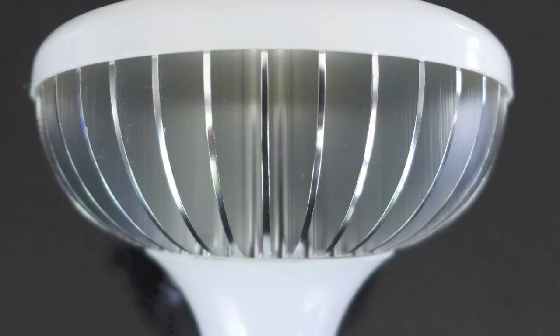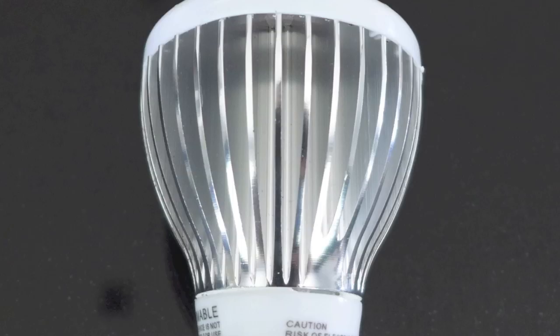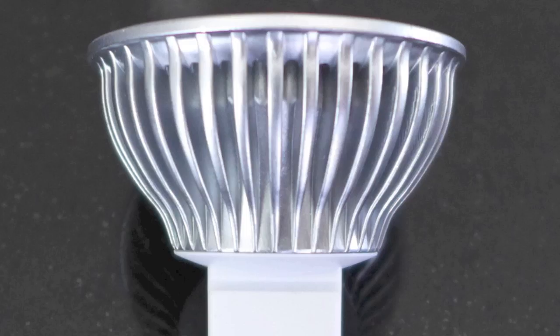The next component all LED bulbs share is the heat sink, usually made of aluminum, which makes up the body of the LED bulb. Unlike the glass bulb of a regular incandescent, the LED heat sink is definitely not empty. Cut in a similar shape to resemble an older bulb type, the heat sink has small fins that allow natural air to flow around the bulb and, by convection, draw the heat generated by the LED chip away and into the air.